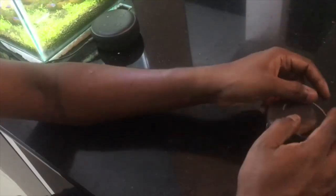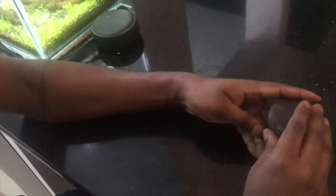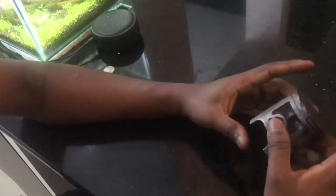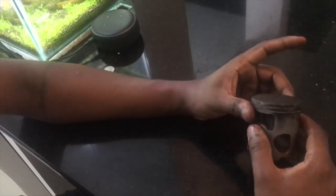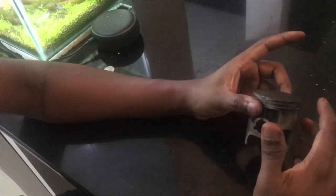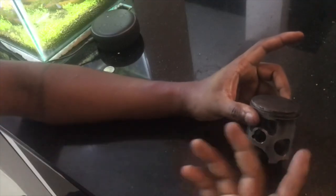So once you get the crank, it is completely different in terms of its wear and tear. So now again, you will have to change the top end bearing, because the old bearing might not work properly, because even the connecting rod will experience a different level of stress now. Maybe it would be too free, or maybe there might be friction, because earlier the connecting rod had play, because of which everything was happening smoothly. So at that time also, I would advise you to change the top end as well as the bottom end bearing.